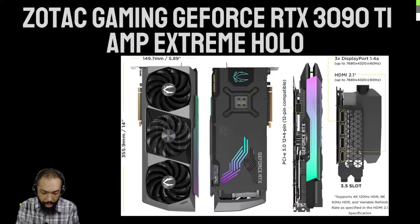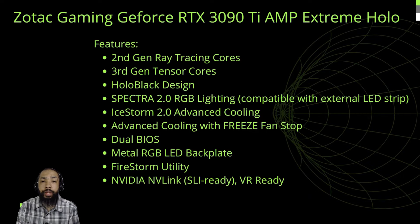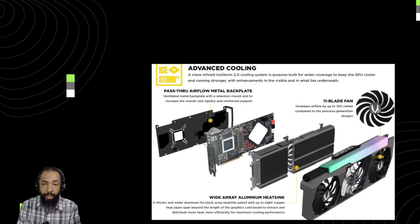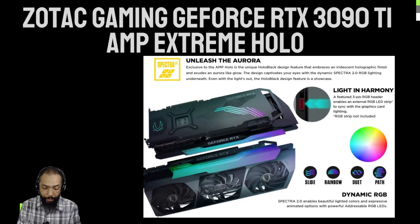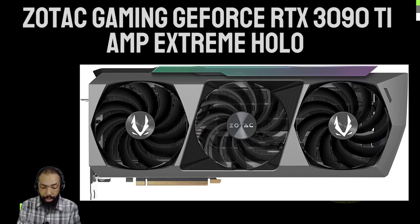Let's talk about the power supply to the card. The RTX 3090 Ti is likewise the first graphics card to debut the new 16-pin power connector, on the NVIDIA Founders Edition card as well as custom-designed cards. The connector is technically capable of up to 600W power supply, and NVIDIA rated the regular board power of the reference RTX 3090 Ti at 450W, which is an entire 100W higher than the RTX 3090, implying that overclocked custom design cards like the Zotac Amp Extreme we're reviewing today could approach or even cross the 450W mark. The 16-pin connector is still extremely new, so all board partners are expected to incorporate a NVIDIA-designed adapter that converts three 8-pin power connectors to a 16-pin connector.